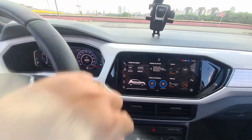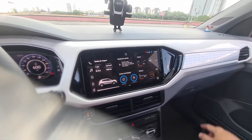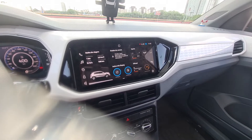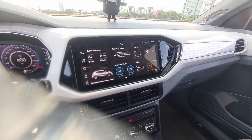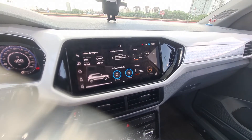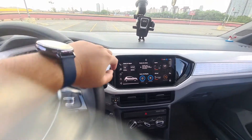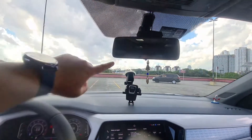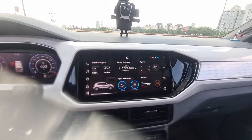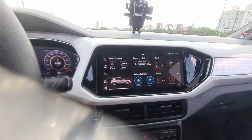Remember: to use the Discovery, you need to make an adaptation on the panel, because the Discovery's central unit doesn't go here — it goes in the panel, so you need to cut the glove box to fit the Discovery's central unit. The wiring is also different. The VW Play uses the vehicle's existing wiring, everything plug and play. The only additional items needed are the microphone, GPS, and USB, since the T-Cross Sense doesn't come with them. With those plus the wiring harness installed, it works.